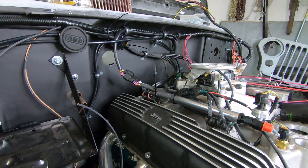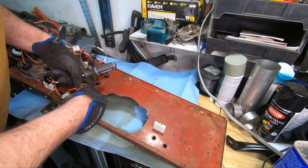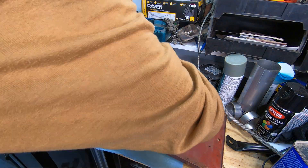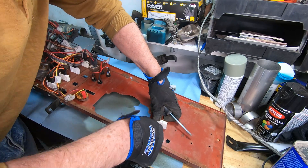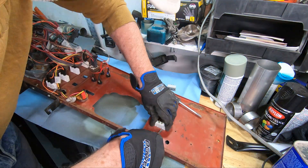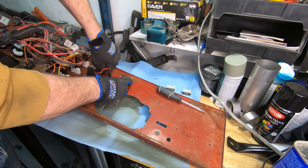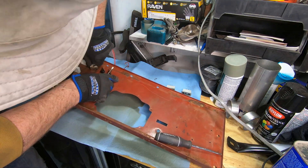I was going to wrap this up but then thought I'd just go see what I can salvage off that old dash and tear it apart. It turns out I was able to get those little plastic indicator clips out of there. You have to start on the keyed end — when you look at the hole in the dash you'll see one side has a slightly wider notch. I started there, pushed the little plastic tab in with a screwdriver while pushing down on the back, and with a little work you can press them right out.